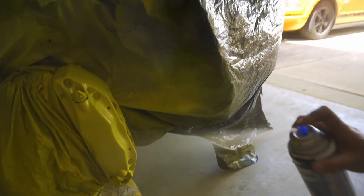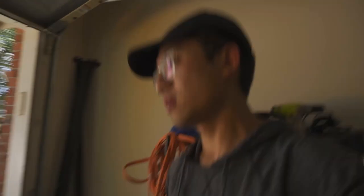The last thing to do is add the clear coat — three coats of clear coat — then let it dry and we're done with the passenger side. We still have to take care of the driver's side as well. Now applying the last coat, which is the clear coat — three coats, five minutes in between. The passenger side, front right, is fully done — primer, paint, and clear coat all on. The driver's side painting is done but still needs clear coat, which will have to wait for another day since I have to leave.